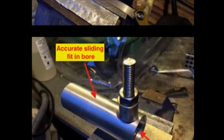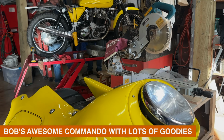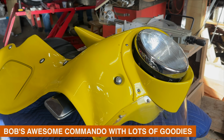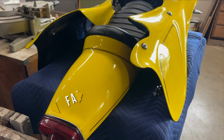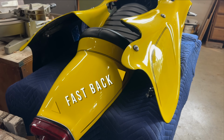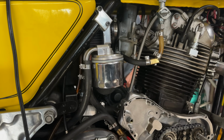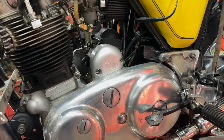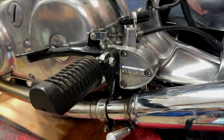I really appreciate it. Normally, if it's just maybe a thousandth out, I would do it on a surface plate with some sandpaper, but as you could tell from the video, it's like 40 thousandths or more even out. Obviously the ears on the flange have got badly damaged, to the extent where I think it's actually damaged the collar of where the O-ring sits, and that shouldn't be a problem, but we'll see what we can do with that next.